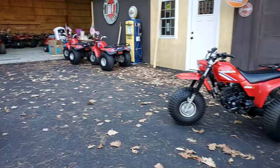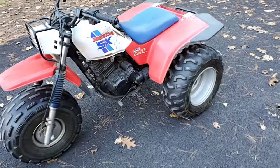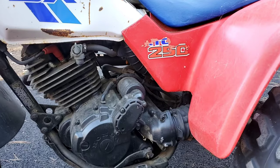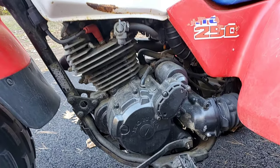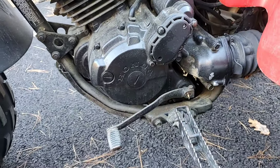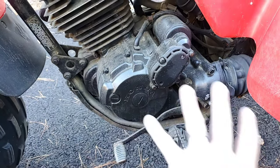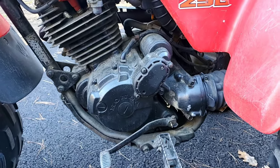And then there comes this guy, the 86. So, couple key things on this. My first instinct was, oh, the chassis is pretty clean on this. Maybe I should swap things over to the other 86 or make this the nice one. But then I realized, wait a minute, this and this should be aluminum. And the bolts weren't painted from the factory. You could see the bolts. This thing's been painted to be cleaned up to look nicer than it is. This shouldn't be painted.